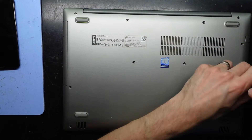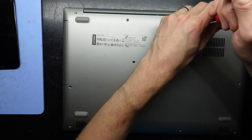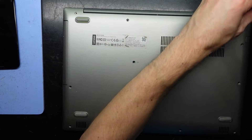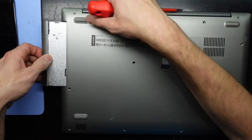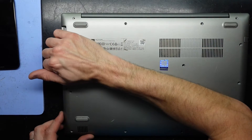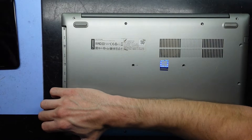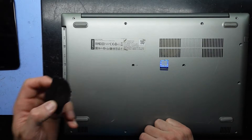So far all these screws are currently the same length. I don't think that will really change with any of these. There may also be a hidden screw under the drive tray. So, one drive tray and we have nothing — get that off to the side. Get a thin pry tool, something like that will do the job.